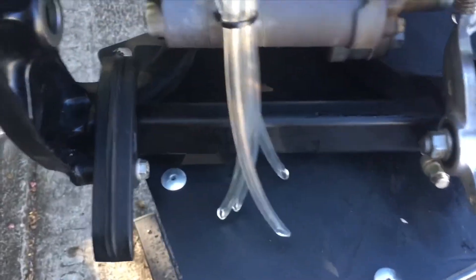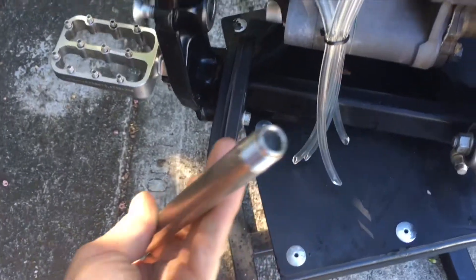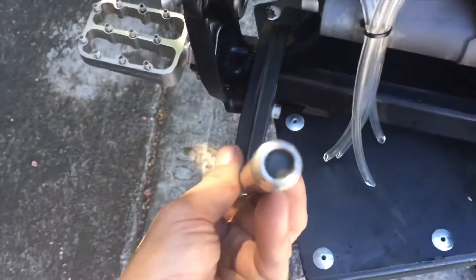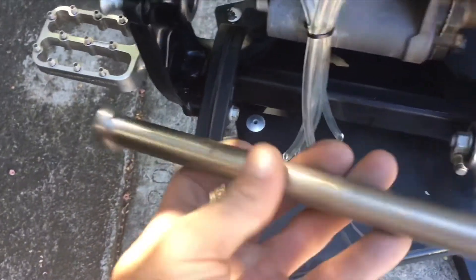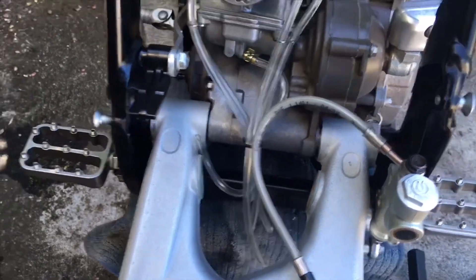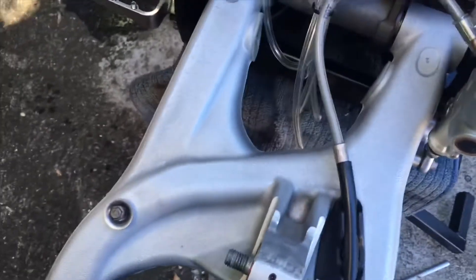It was a little bit dry to get out but everything came out nice and clean. Didn't have to pound apart the threads or anything to get it out — used a stick for a drift. I did ruin the little rubber cap but I pounded it back inside so it's still sealed. Got the swing arm all buttoned up. Thank God KTM put some good grease in there. Everything looked good, and I know that any of the other people that ever owned this thing certainly never greased it, so good job KTM.